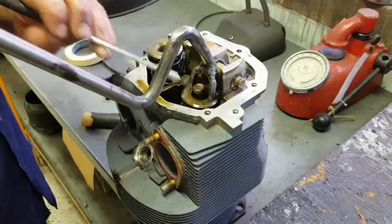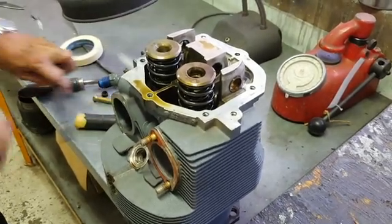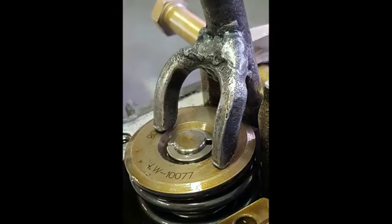Those little circlips — or collets as they're properly called — that's what young Ben was helping with, trying to poke them back in. This handy tool was made some time ago at the Royal Aero Club to get the valve springs off — a really interesting piece of equipment. This is a close-up photo of the valve spring. You can see here the valve stem cap, and the circular bits around it are the collets, which need to be removed to take off the valve spring from the stem.